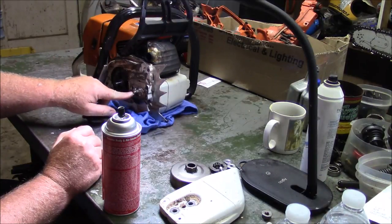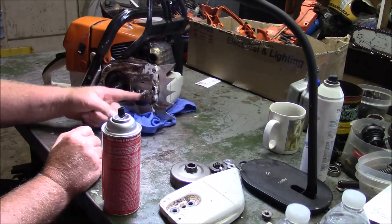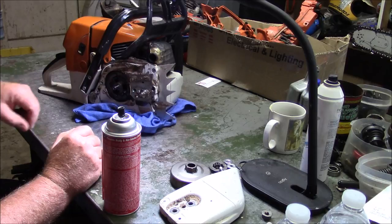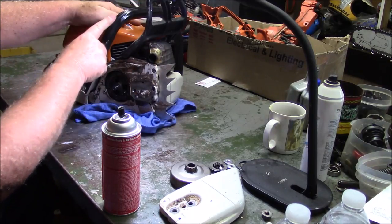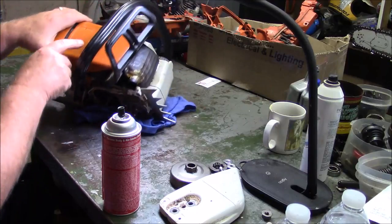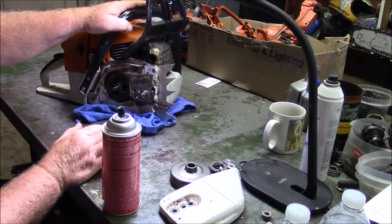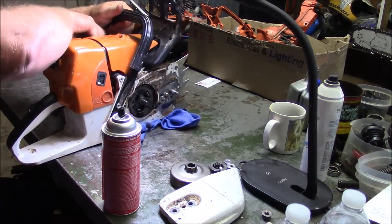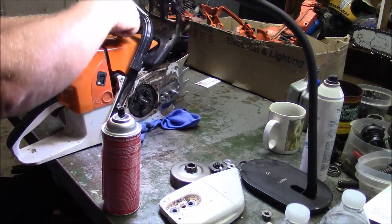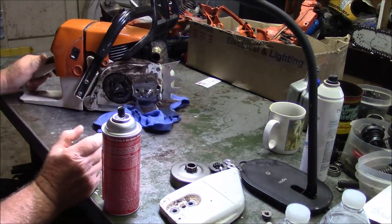I've already replaced the guts of the bar adjustment — that's OEM shimmed. This is an HL Supply highway handle — that survived. Husqvarna decomp has survived. And believe it or not, that top end has survived; that thing's still got great compression. This saw really runs. This is the one that has finger ports put into that cylinder by hand.